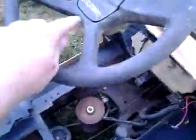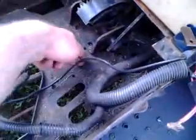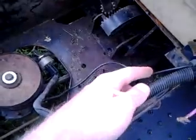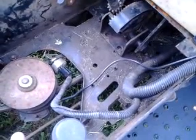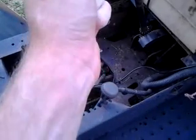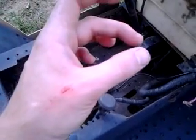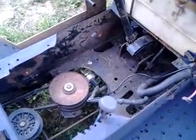The steering came off another rally — you can see it says rally right here — it's the Craftsman-type steering with the gear and the bar. I took it apart and put the steering bar on top. On most Craftsman rallies the bar goes down through the bottom and steers from the bottom. I like this setup a lot better. The MTD stock steering just kept breaking the bolt that goes through the bottom — there's a little plastic bushing through the frame that wears out; it's just not a very good setup.